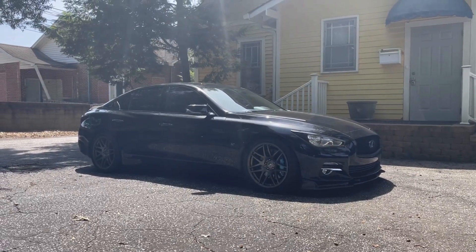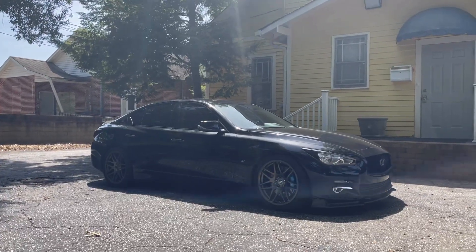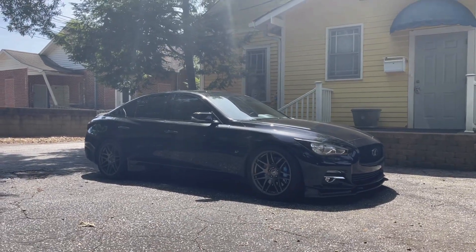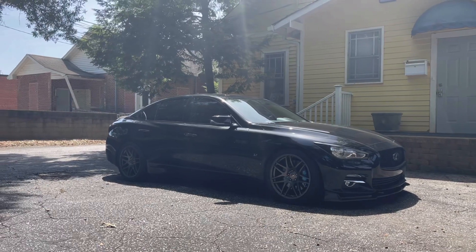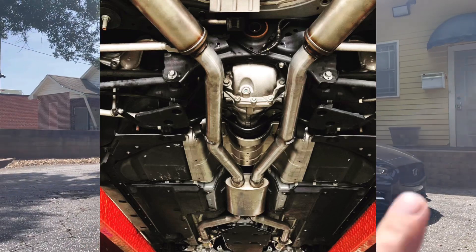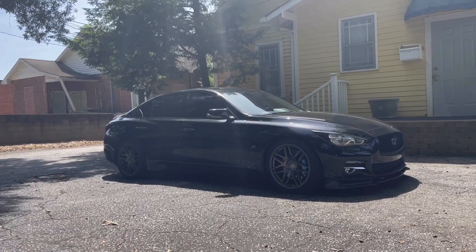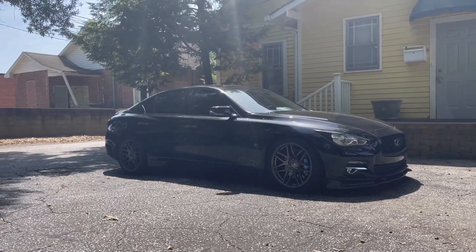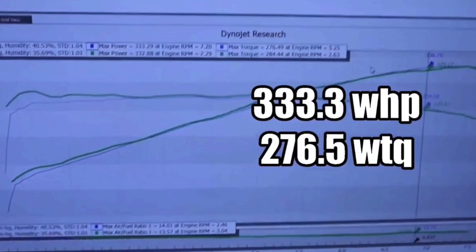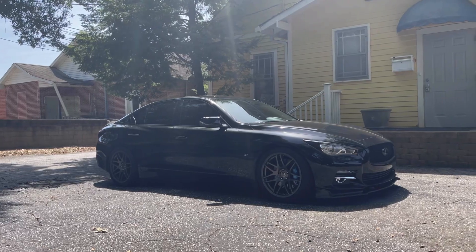Eventually I wanted to make a change — get a different exhaust tone and free up a little additional flow. So I upgraded to a two and a half inch custom cat-back system, the Sweet Culture Studios cat-back with the Borla mid muffler and FlowFX resonators — a two and a half inch system complete from test pipes through cat-back. About a year after my first dyno session, I put the car back on the dyno and made 334 horsepower and 276 foot-pounds of torque.